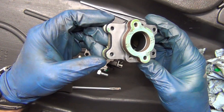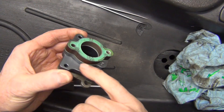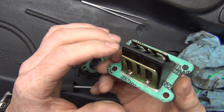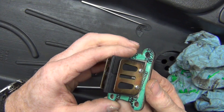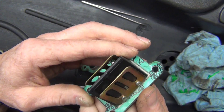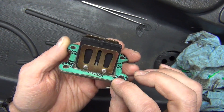So these are your reeds — this is what you see when looking down at the carburetor. The carburetor actually mounts onto that; it's just held on by two bolts. If you've got some gaskets in here, it's a good idea to replace them so you don't get a vacuum leak. These are your reeds in a two-stroke engine — they're like a valve, a one-way valve that allows your air-fuel mixture to go through this way. You can see it kind of open or stick up just a little. They vibrate like crazy and allow the air-fuel mixture to come in. You want to check them — just make sure they're working properly. Check them for damage at the end; it's like crack the whip, you get most of the damage at the end. But sometimes they can split or have other damage just about anywhere. Just make sure they're okay.